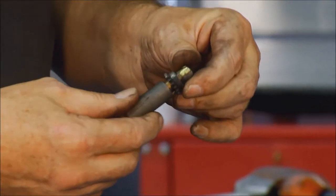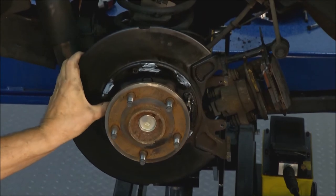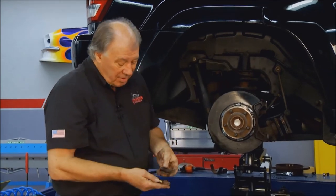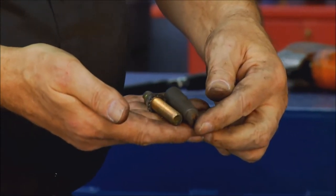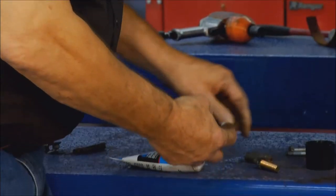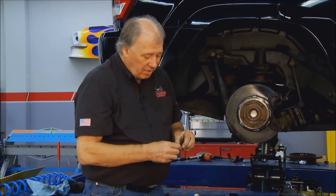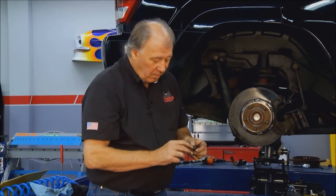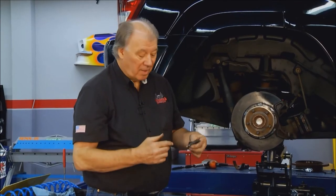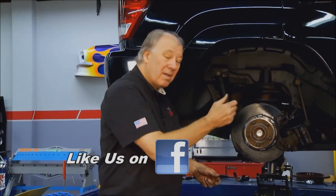The key thing is the adjuster. Here's what it looks like — it's going to fit right here between the shoes. Behind that there's a little opening with a little rubber plug in there. You pop that out — that's how you adjust it after you have it all assembled. If you take the adjuster apart, you want to take a little bit of high-temperature lubricant and put some on the threads around here, because it's going to have to turn real easy so you can adjust it. Always put a little bit here where the backing plates on the shoes ride — this absorbs any vibration. I'm going to go ahead and put my shoes together. In the meantime, let's check out Sam and see how he's coming with that rotor.